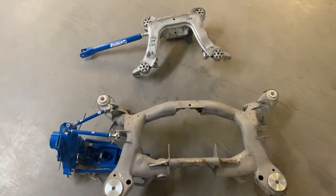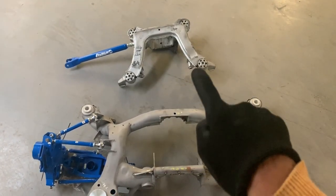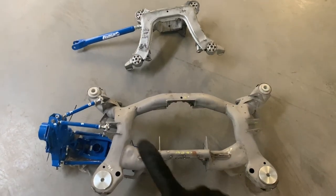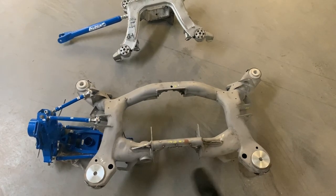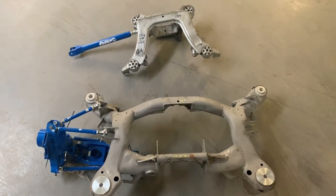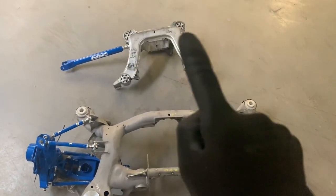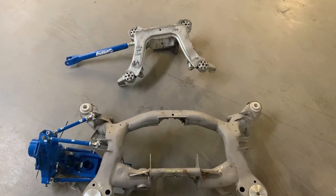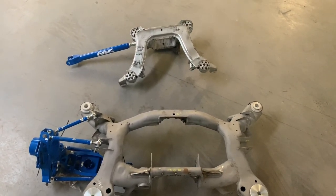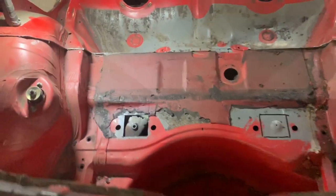There's also one problem with it. As you can see over here, the pickup points of the suspension are much closer to the center of the car compared to the E90, which of course has a much beefier subframe because that car is much newer. However, that means there's much more leverage on the subframe and the pickup points are not spreading out as far to handle that. So what sometimes happens is that these chassis have tears. On the underside it happens quite a lot, and sometimes if you keep driving it, it also happens on the top. So we have a solution for that.